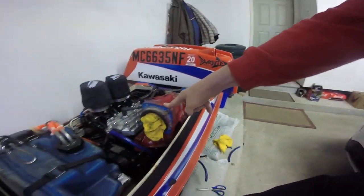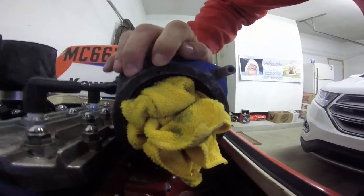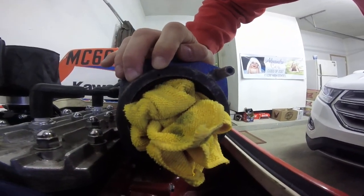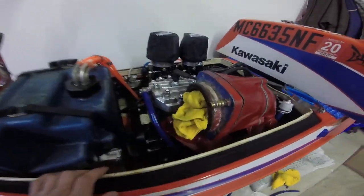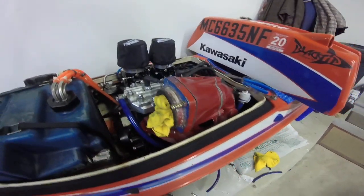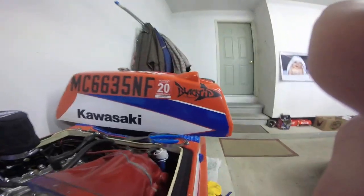And right as I was taking this thing off, about to pretty much give up on it because I had no clue why it kept melting stuff, I was looking around on here and I found this little hole that seems to be the only cooling hole. And so I stuck some wire through it. It was completely clogged, and I couldn't even really see it. I just noticed that it was a little bit discolored, so I thought that there might be a hole there. There doesn't appear to be any more holes. That is the only one.